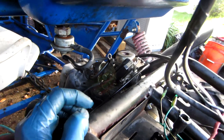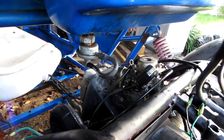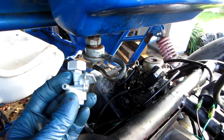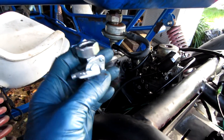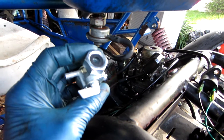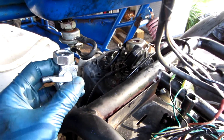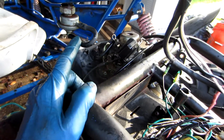So this is no good. Now I could replace it, but to be honest, I absolutely hate these things because they fail so often and there's no way to actually shut off the fuel flow manually. So instead I'm going to be replacing it with this standard fuel petcock. You'll need to match up the threads on the tank — this one, if my memory serves me correct, is an M16 by 1.5. So we're going to put that on there and I'm going to run an inline fuel filter, so that way we don't have to worry about this vacuum petcock anymore.